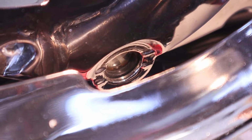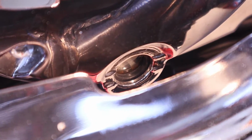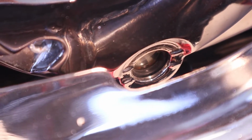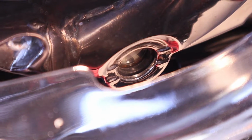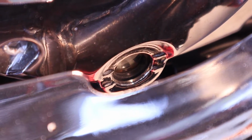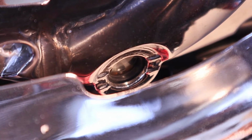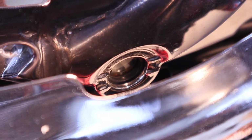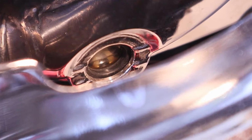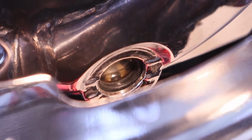After putting the oil in, you can check the fill level. It's on the bottom right-hand side of the bike, just below the exhaust manifold. And you can see there's little marks, and you want the oil between those marks. In this particular case, it's not between the two marks, so we'll go ahead and put a little bit more oil. Okay, so we put a little bit more oil, and now if you could see, the oil level line is between the two marks.